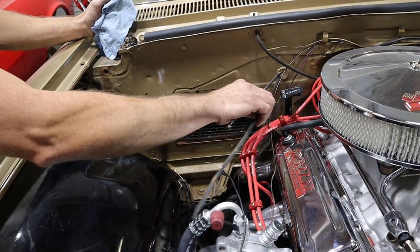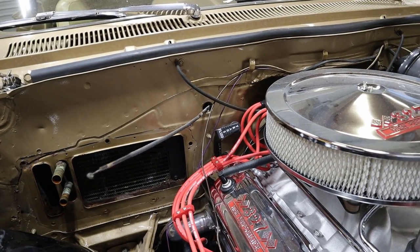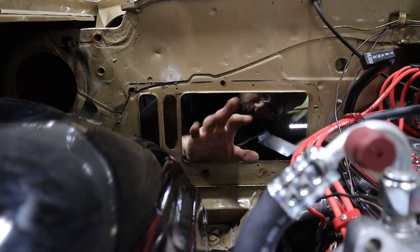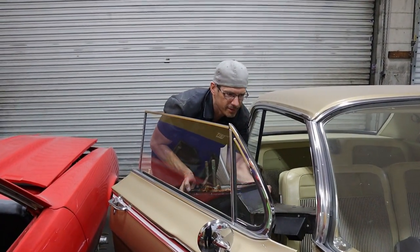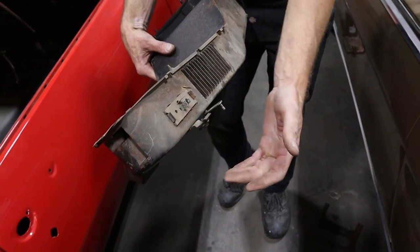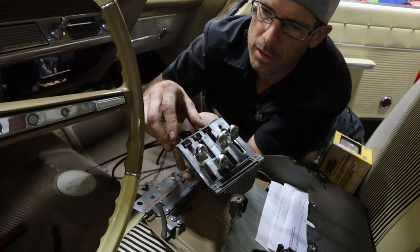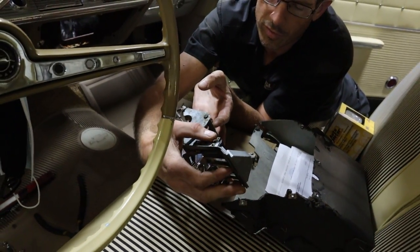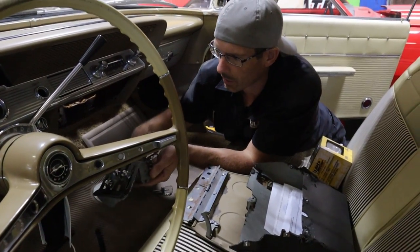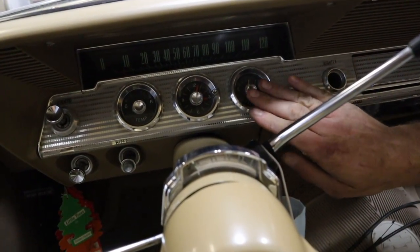Got the two cables. We got it out. This is all you get on the inside here. You have one more cable and one bolt over here that held it on the inside, and the resistor. Got the controls all out — the whole assembly. Just unplug and the knobs are going to fall off. Just have the blower switch harness, a bulb, and three cables — got all that out of the way. It has four screws holding it in: two on the bottom of the dash and two on top.